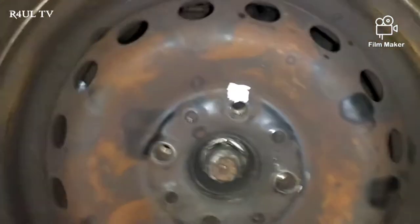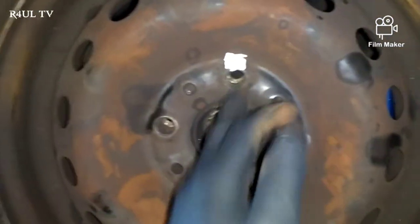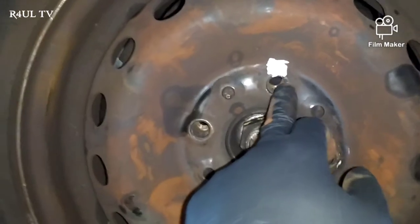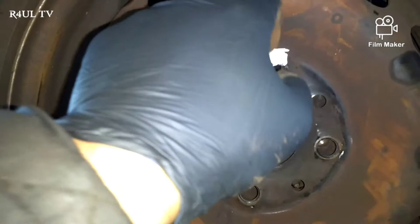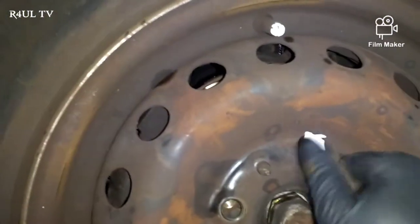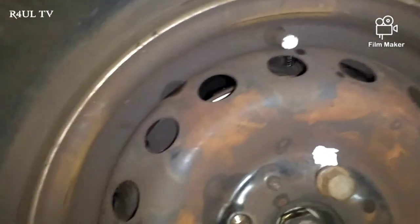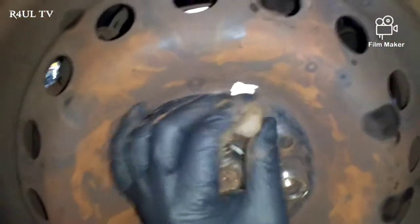Right, so what you do is, I've marked it for educational purposes, you see this valve, normally it's supposed to be in line with the bolt hole, for some reason it's not, maybe it's just a bit out. So the bolt hole that's closest to the valve, we put the bolt in there, as you can see, I've marked it. You can even tighten that up full whack if you want. I'm just going to do it hand tight for now, because I just want to show you guys.